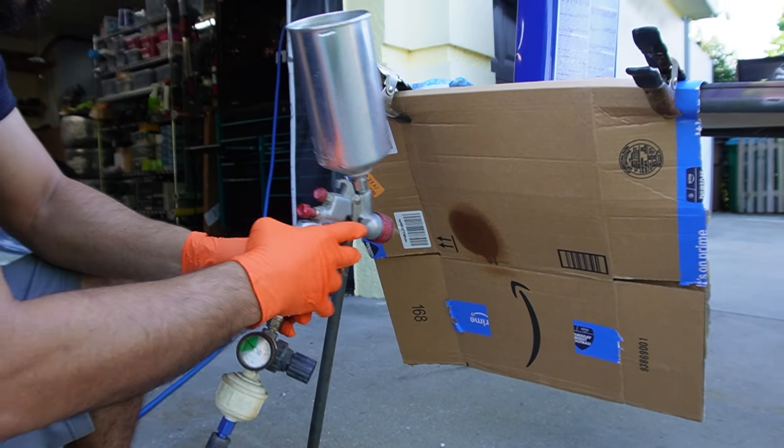I didn't clean it very well. I don't remember painting red, so that's concerning. The last car I painted was white - my Integra. You can see there's still a little residue in there. I'm changing to the 1.5 tip, the biggest nozzle I have, so more material comes out for the primer. I'd prefer a 1.7 but a 1.5 will have to do.